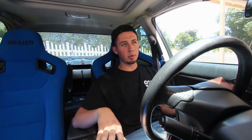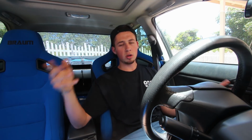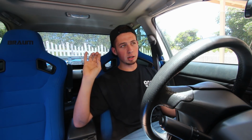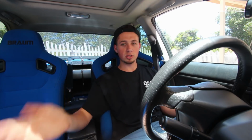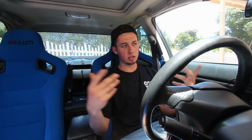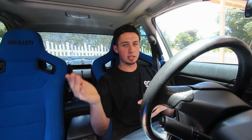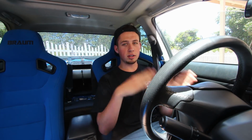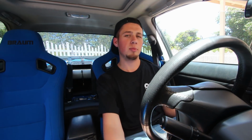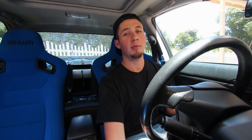I might be wrong on that, but 83 is not possible, and the only way people are getting those numbers is something mechanically being stuck advanced, which is my issue. I'm pretty sure it's the fact that my gear itself is stuck and is not phasing how it should. So yeah, hopefully that made sense. I tried to explain it the best that I could. Definitely comment down below if you think I'm on the right track.